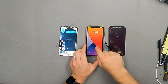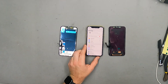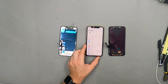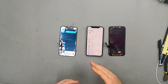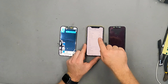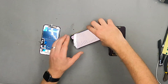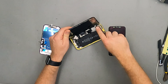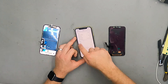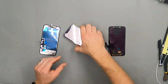We're back — this is the same phone. It's actually been about 5 or 6 days since I recorded the first part; it was such a long download and I just haven't got around to doing the second part. That has made a difference which I'll explain in a little while. If I go to Settings > General > About you can see it's now on iOS 15, the latest beta. The display currently fitted has the originally paired IC, so when it boots it recognizes the original IC and shows no notification about verifying the genuine Apple display — this display works fine on iOS 15.